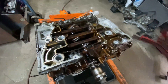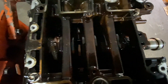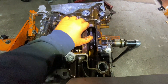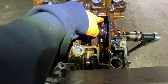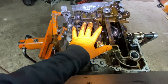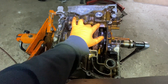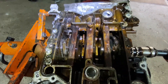Now we can see the crank and the pistons. Let me get a light. You can see cylinder number four, number one — there you go. That's the engine knock, and it's a big one. With that much play, it destroyed the crank and the connecting rod. At a minimum I'm going to rebuild this block. Since it's already apart, I'm going to examine it. At a minimum we're going to need a crankshaft, a connecting rod, main bearings, and rod bearings.